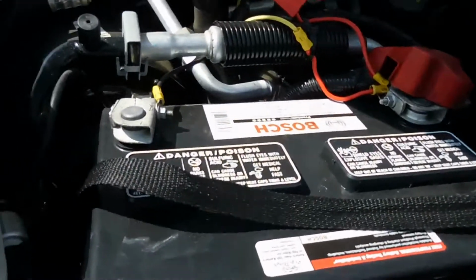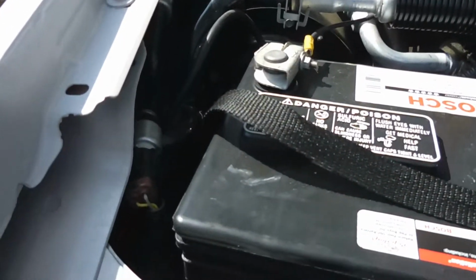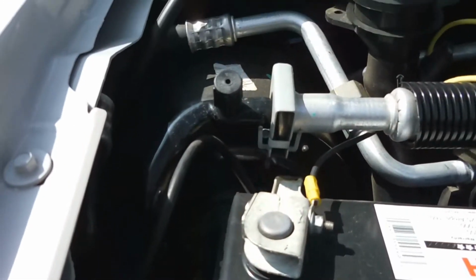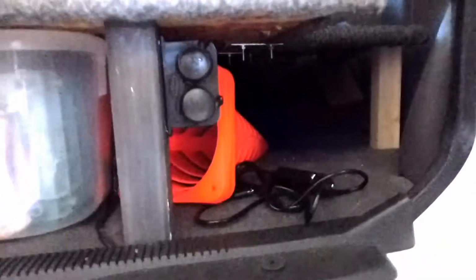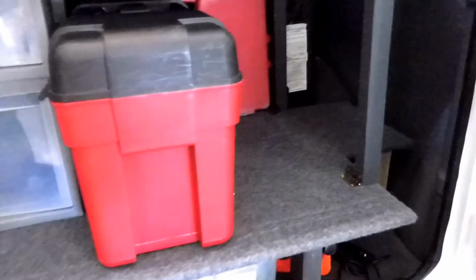battery compartment, where I'll need to find a place to put that isolation switch. And there's not access to any fender well mounting in this battery area, and more than likely I'm going to fit it down in here. Well, I fabricated a platform and extended the area here to place that auxiliary battery. And again, there's storage underneath there. I'll probably put a little plastic tub and contain whatever I store there. Again, this platform, very strong. And this toolbox will slide back in there, as shown earlier.